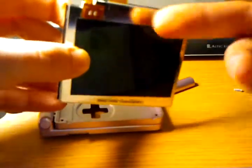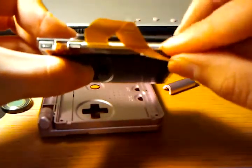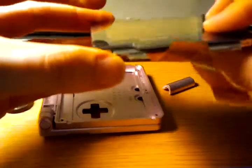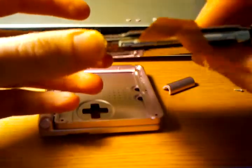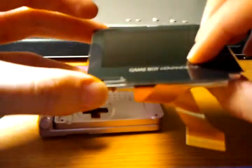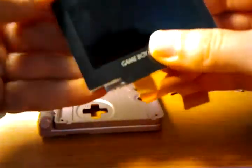Just like any other LCD, you've got your back shielding, then a white middle layer which holds the light box, and then on the very front is the glass which sits over the light box for the LCD, followed by a surrounding metallic can to hold the entire enclosure together — everything is held together by little clips. You can get in there with your pocket knife and gently unhinge those. Finally there's a plastic bezel on the front. It's almost identical to the older frontlit version.